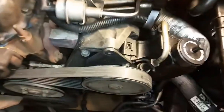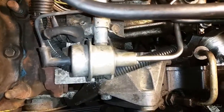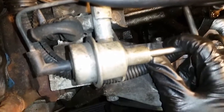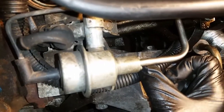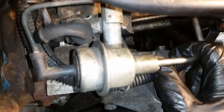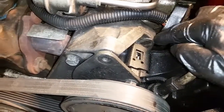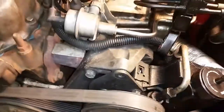Next thing you want to do is loosen two bolts in the back of the power steering pump. You can see one on the top right here, and there's one below it. I didn't have one on mine, but I'm not surprised since it's 30 years old. There should be one below at about 3 inches. All you have to do is loosen those because they're on a slot type of hole instead of just a hole, and those will slide a little bit. Just loosen those two in the back.